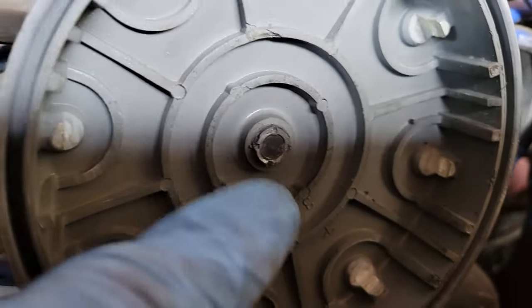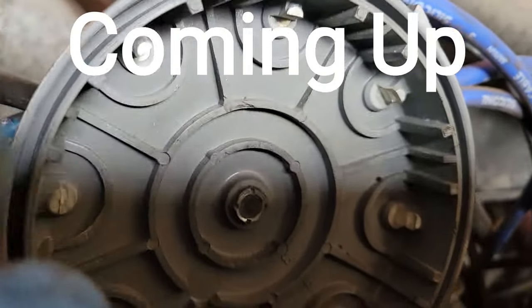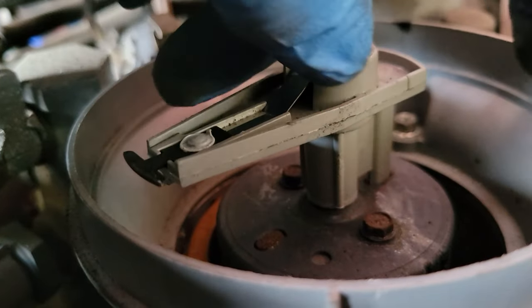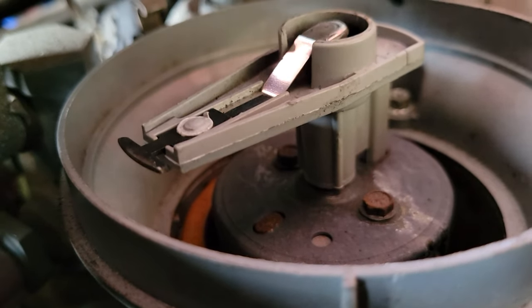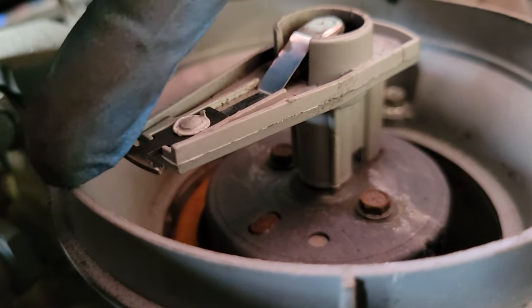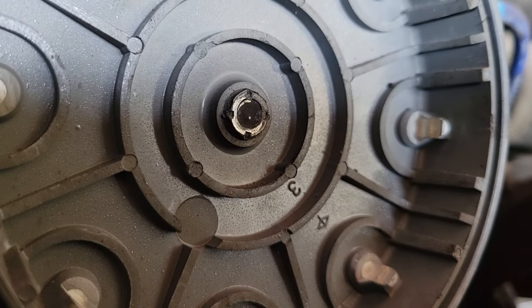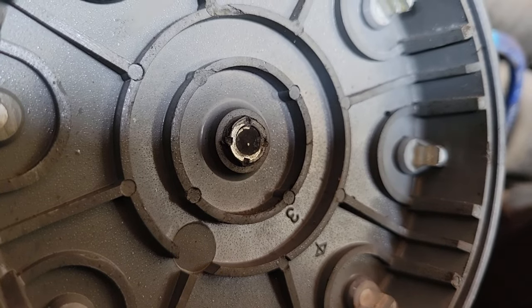The third thing is the center terminal. There should be a button sticking out that you should be able to press in and out because it's spring loaded. That spring loaded button will make contact with the top part of your rotor, and the spark energy will go from this tip to the terminals inside the distributor cap. If that button's worn out or sticking, that can cause your spark to come and go and cause intermittent misfires or just a complete no start altogether.